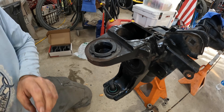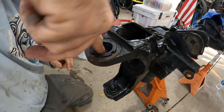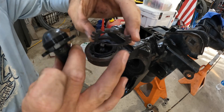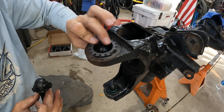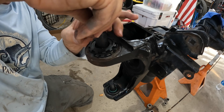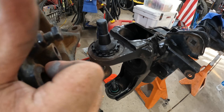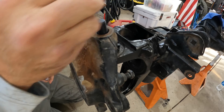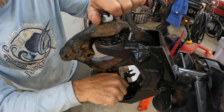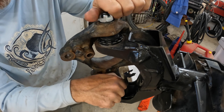Got the pin in. We're going to drop this in place. It's locked in there. Get the lock collar on here — two tabs down against the C, all the other tabs are up. Now we'll put the stud in. Go ahead and put the dust cap on. Now guess what drops on super easy here and stays in place — ta-da. Let me caution you against something I found out doing the other side. The instructions say to torque the fasteners down first, then put the preload on the ball joint after you torque those down.